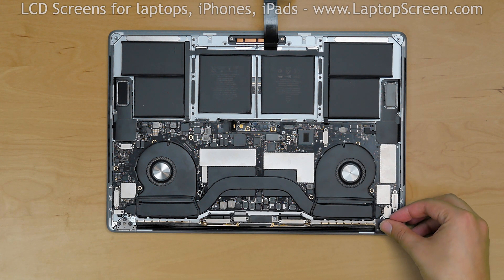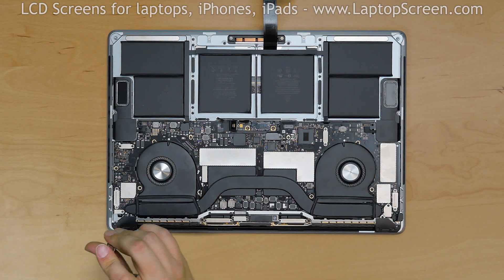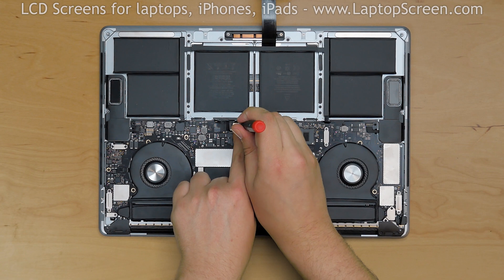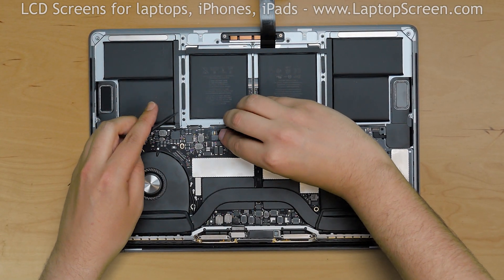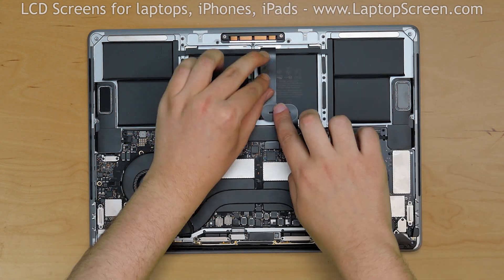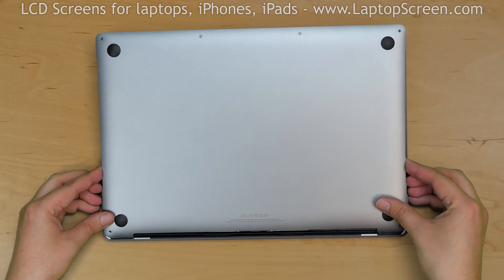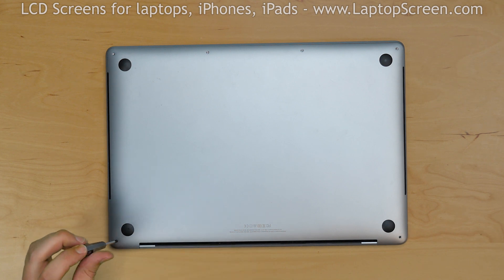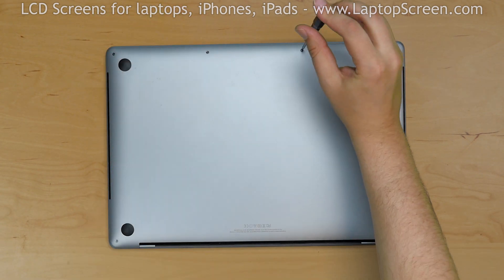Replace the right hinge cover and secure it with two Torx 3 screws. Replace the left hinge cover and secure it with two Torx 3 screws. Bend down the main power leads towards the battery control circuit and secure with the wide cap Torx 5 screw. Replace the black plastic cover over the battery control circuit and lock the connector's counter lever. Reconnect the touchpad connector, smooth down its flex cable, replace the connector shield, and secure it with two Torx 3 screws. Place the bottom cover a quarter inch above the hinge edge and slide it into place. Snap in the two mid mounting points, then replace the two longer Pentalobe 1.2 screws near the hinge and the four Pentalobe 1.2 screws on the front edge.